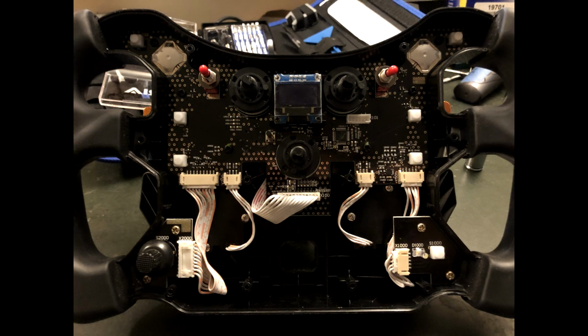They're just self-tapping screws and are not tight to undo and shouldn't be over-tightened when you put it back together. This is exactly the kind of fixing where hand-fisted gorillas will over-tighten them and strip the plastic thread. The faceplate just lifts off. The P and N buttons will fall out if you tip it, the rest should be held in place by the button caps, assuming that you keep them on. But just lift it off and set it carefully aside.